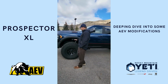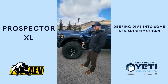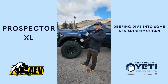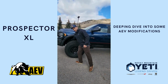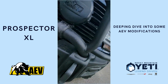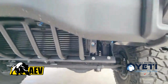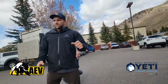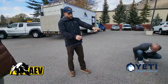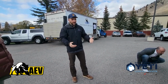So, well, again, the whole idea was fitting a 40-inch tire. A 40-inch tire with our wheel on it weighs like 160 pounds times 2, so that's a lot of weight in the steering. So there's a PSC hydraulic steering assist. So this one on the camera, down low. Yep. So it's got hydraulic lines going to your steering. So what that does is it's basically a big shock. So when you put input into the steering wheel, this hydraulic ram forces the tires back and forth. So you're not having to muscle through it. Is the easiest way to explain it.